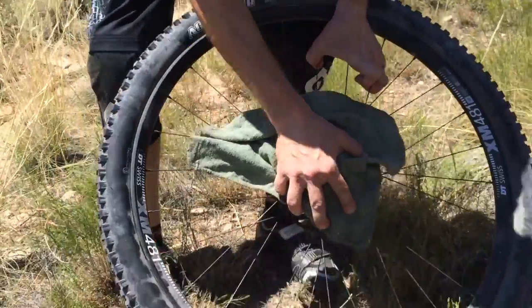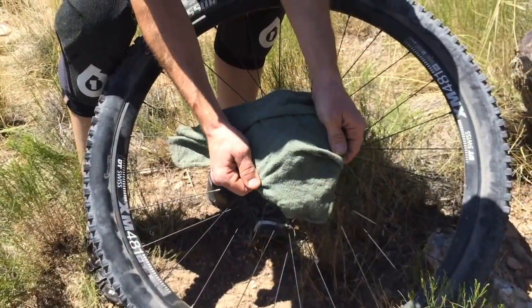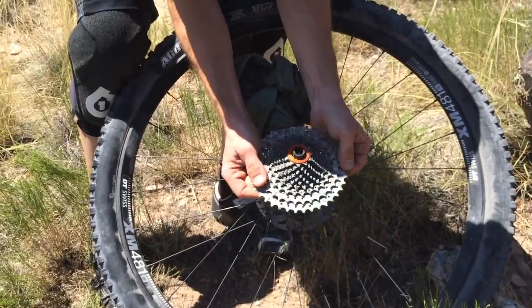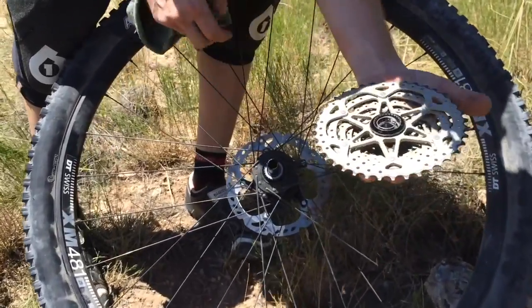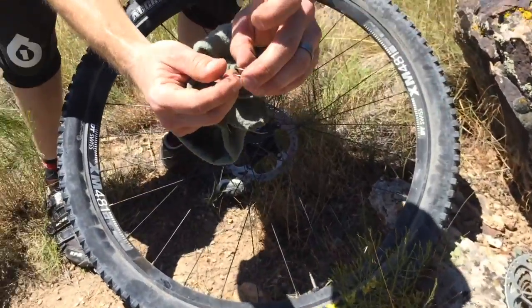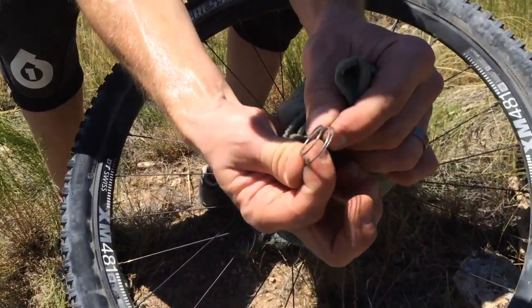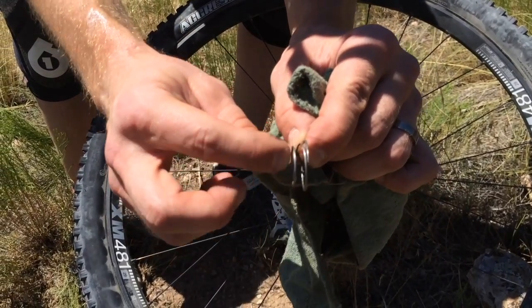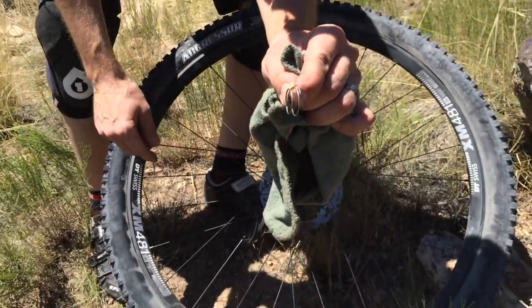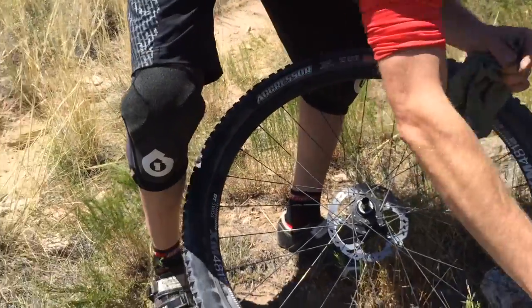Now that the end cap is off, I'm just going to lift this off. Move the rag out of the way so you can see. Once that's off, we have the cassette. One spring is actually in here — you saw I took that out. Key thing to note with these springs is that the small portion of the coil does touch the back of the star ratchet plate. More on that in just a second.